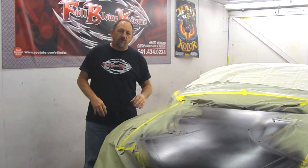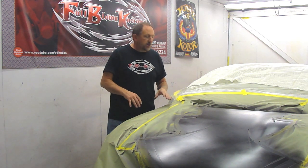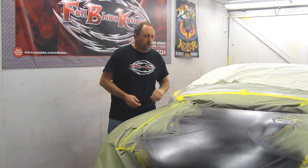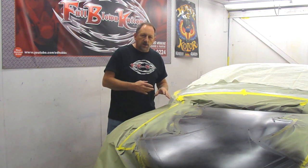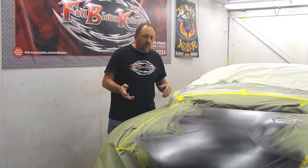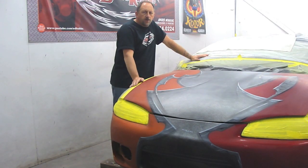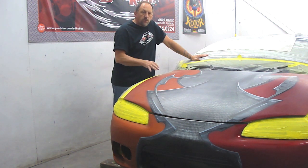I'm not going to explain too much about the carbon fiber because I already have videos showing how to do that. I'm going to use this pad — it's a rug pad that goes under rugs for non-slip — and it resembles what I consider carbon fiber. I've got my black base sprayed down, I'll lay this over top of it, then take a fine metallic silver and spray it back across, shift it just a little bit, and do it one more time. We got everything spotted in — all the candy done, the carbon fiber, the stone effect, all the bevel edges shadowed. I wiped it down with wax and grease remover, went back over with a waterborne cleaner, and now I'm going to put three coats of clear on it, let it set for a day, then color sand and buff it.